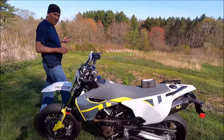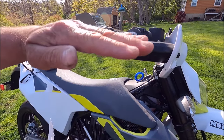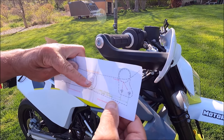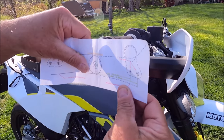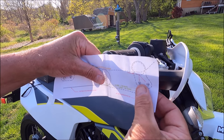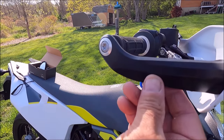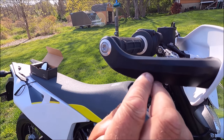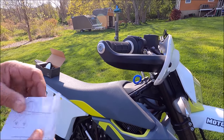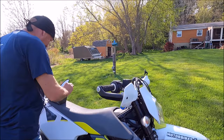Start to install the second one and we'll see how it goes. Again guys, these aren't KTM stock guards — they're a little bit different. The KTMs come out straight. So what I did was I lined this up — that's the NDS bar right here. I line that up perfectly and then come straight down. See these two little holes? Those are the ones they want you to screw. I took a little pointy tool, a sharp little piece of metal, and I made two dots — one there and one there — and they line up perfectly with the distance of these. Let's go ahead and start to drill these.